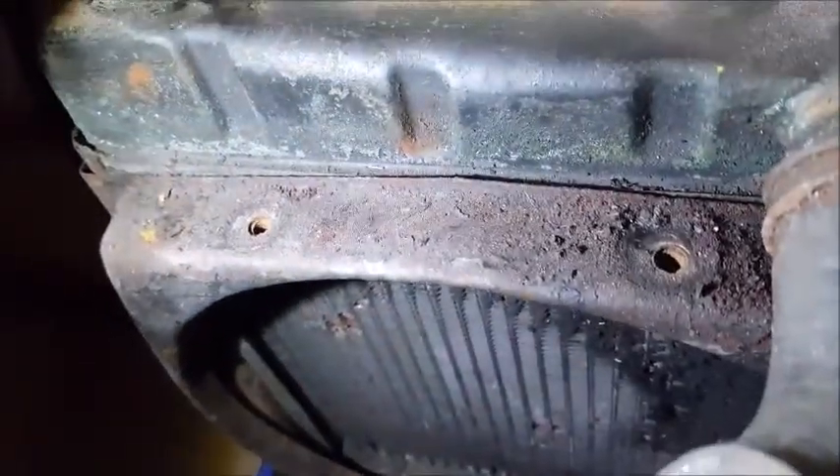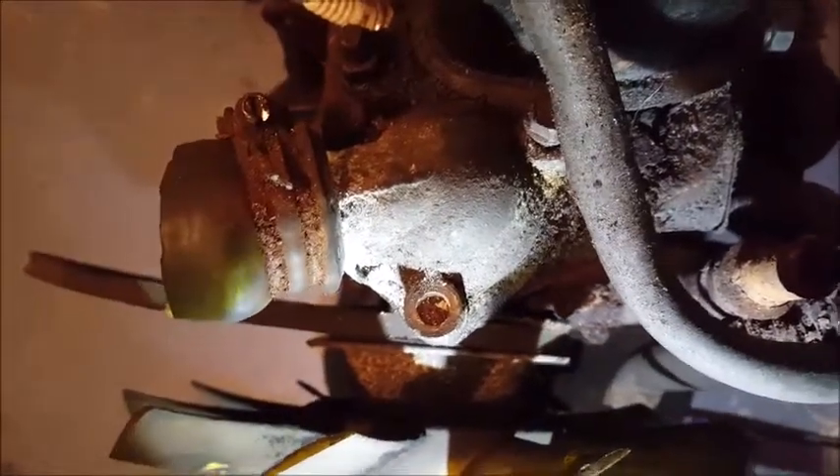Next thing to take off — you can see on this picture — is the bracket holding the radiator onto the thermostat. When it goes on the radiator, it's three bolts in total: two go on here at the top of the radiator — they came off fairly simply. The one on the thermostat, as we can see here, just sheared off completely. At a later date, when I take that thermostat off, I'll get a stud extractor and get that ripped out. But it's just so rusty it actually just gave way. So the bracket, once those three are off, just lifts off — it holds the radiator steady in place.